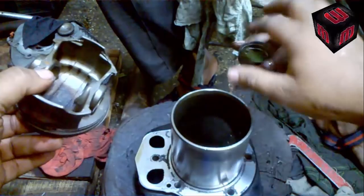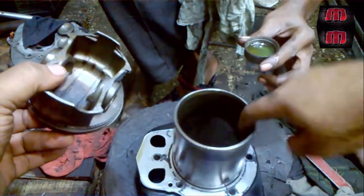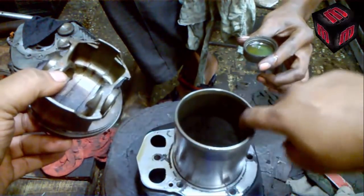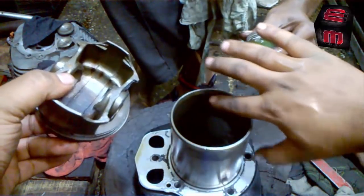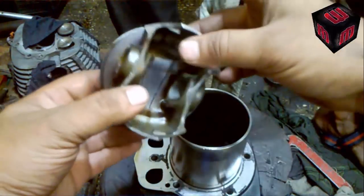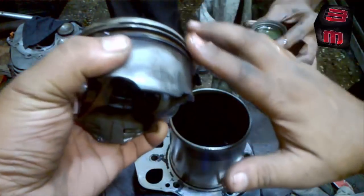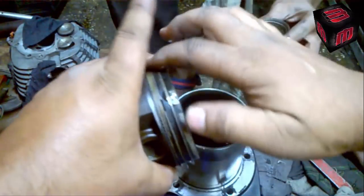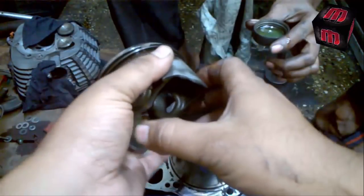The simple way to insert the piston in just a few seconds — first apply some lubrication or engine assembly lube if you have it. Some guys must be thinking why install the piston first in the block rather than when it is on the engine. That is also one procedure, but sometimes while inserting, the piston rings get bent very easily.